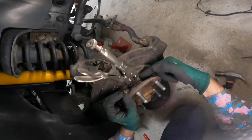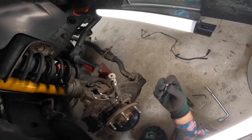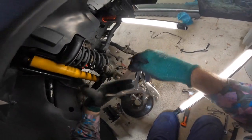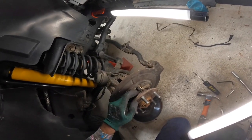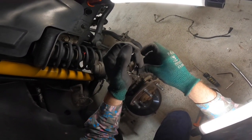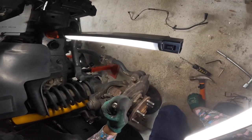We've got this little grommet out that was holding the speed sensor in just here — put that in a safe place. I did have to get a flat-head screwdriver and just tap it lightly at one corner; it was just a little bit corroded and rusted. Now we can go along and actually remove the speed sensor itself. This is where the alligator clamps come in handy because it's very tight in there, or you can get a flathead screwdriver and just lift it up from the corner.